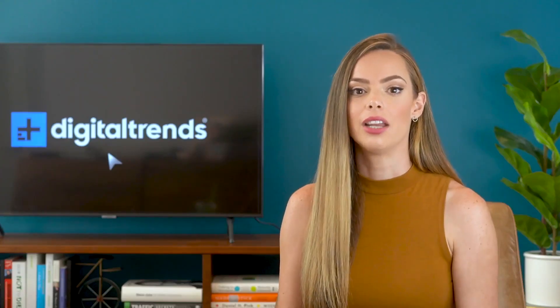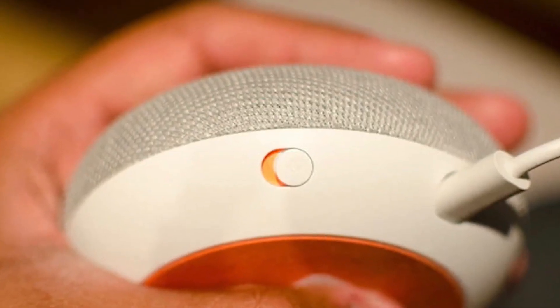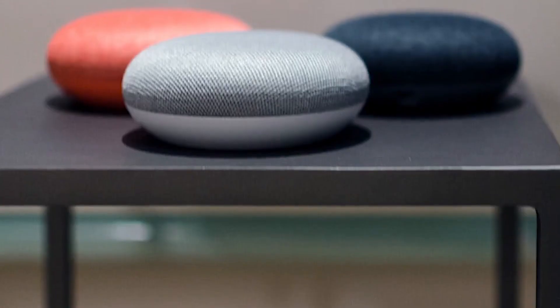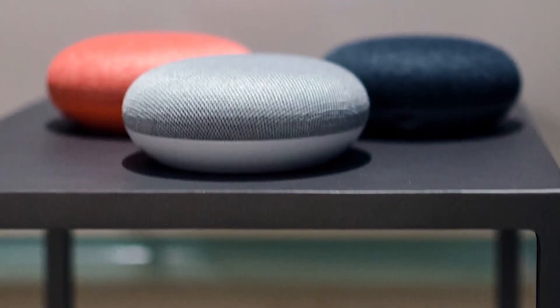For the second-gen, you should find a microphone on-off switch on the side of the device. Be sure to flip it to off. The LED lights on the top of your speaker should pulse orange. Press and hold the center of the Nest Mini right where the lights are located. You'll hear a chime once. After about five seconds, your device will automatically begin to factory reset. Once you hear the chime, the reset process is complete.